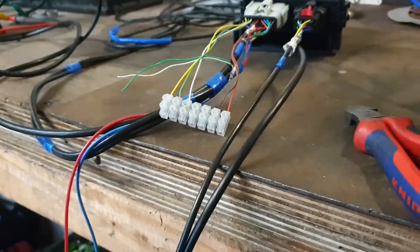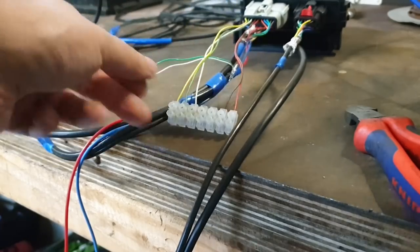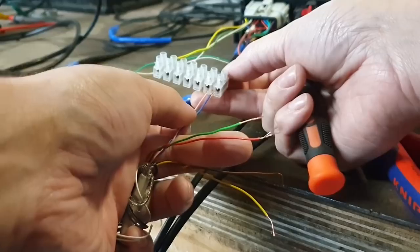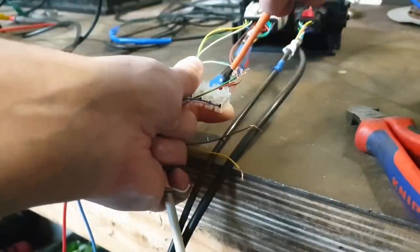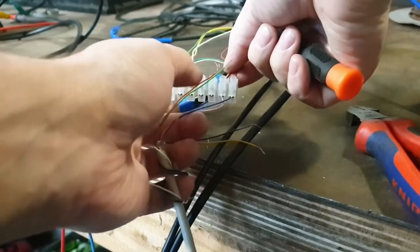So what I strongly recommend that you do at this time is to bring out your resolver wires to a piece of connector block like this from the VCU. And the reason is that it lets us easily change our combinations depending on what we need to test. So the first thing that we're going to connect is the resolver exciter, and that is the blue and the pink pair that we identified previously. I'm going to connect those to the exciter output from our VCU. The polarity of these does not matter. It does not matter if you swap the polarity of these, because in doing so, you would simply be swapping the polarity of both the feedback windings, and there is no point in doing that.